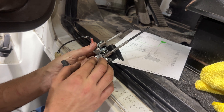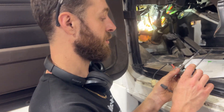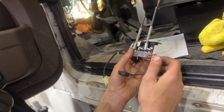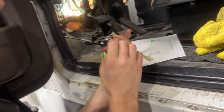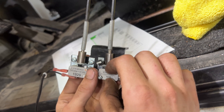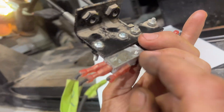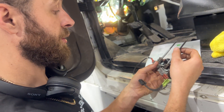These are pretty expensive. If you have the hookup through International and get a deal, it's like 280 bucks for the switch assembly — just this long antenna piece with the switch in it. But you can actually buy just the switch on Amazon for like 30 bucks. You have to have some know-how, but I just had some small screws, shaved off the rivets, pulled the top cover plate off, removed the switch, put the new one in, and used coarse thread machine screws that threaded into the backing plate quite well. Just make sure it works before you put it back together.